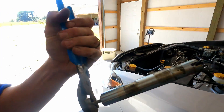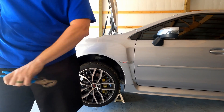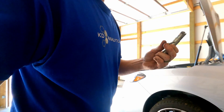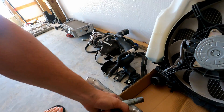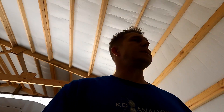Okay so it's out. As you can see the hole's empty. The clutch arm is free. I've got the spring in my hand. It's a typical 10 millimeter bolt. I just used a spare one I had, but to avoid tearing up one of your bolts — if you need help figuring out which thread pitch it is you could use one of your coolant crossover bolts. I would go get a different bolt from the hardware store so you don't tear up your bolts that you need for the motor. I'm actually gonna leave that bolt threaded in there for now to give me something to push against it.